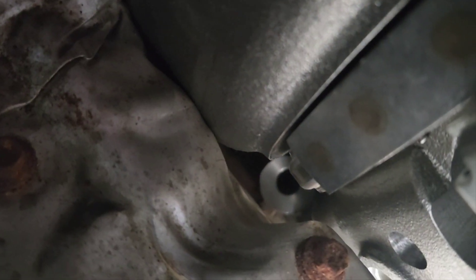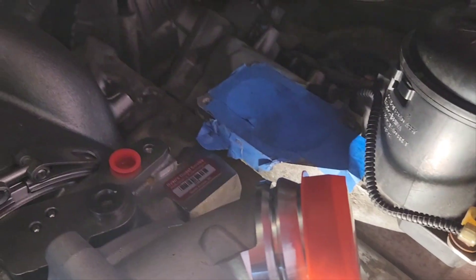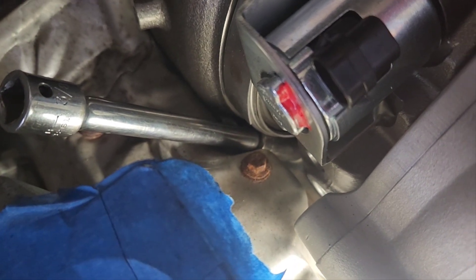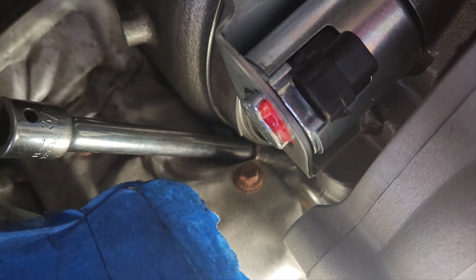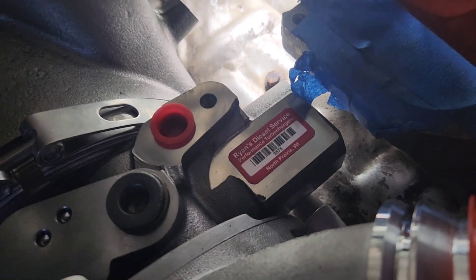Just to open this area up — you can see the bolt hole right in the middle on screen. Same thing here — little hole right there in the middle, I can just barely make it through, but it needs to be widened up a little bit. I was actually able to get the passenger side rear bolt in. I used a quarter-inch extension and a long 13mm socket. That made it through — I was able to wiggle the bolt in with the magnet rod and now it's in, just tightening it up. Going to try the same on the other side — it's hand-tight.